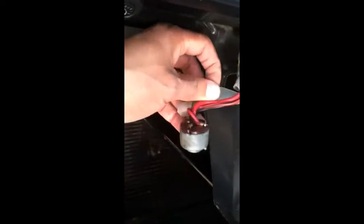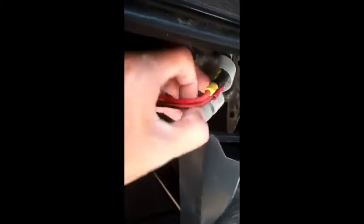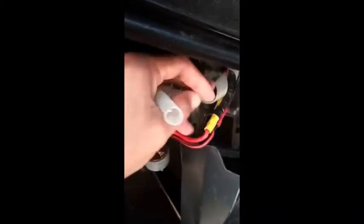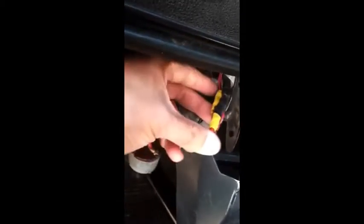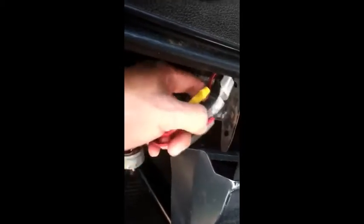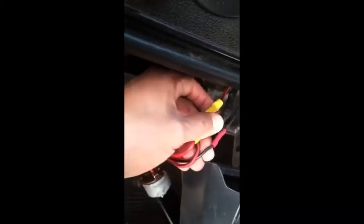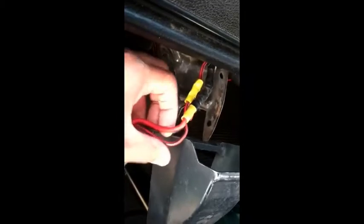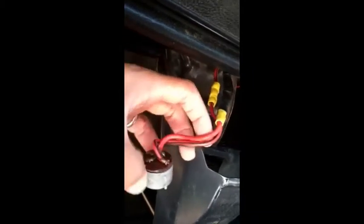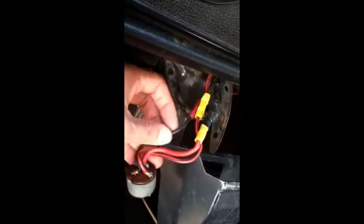There's this plastic wiring that covers it. I've already replaced this — this is from another bus. You can see my wiring job here. It could be that these are loose, that's why my car's not starting. One way I could test it is by touching these two together and basically bypassing this to see if that's what the problem is — almost like jumpstarting a car. And that's my car trying to start.